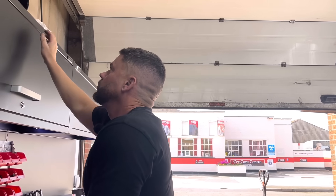It's all glued on these days — and a lot of stuff's glued together. At the end of the day, it's structurally fine because you've got most of the original quarter panels on — you've only got an over-fender bonded to the quarter panel, so the structure's still there. Same with the C pillar kit — it's holding the rear window and it's a plastic one anyway. I was watching Matt Armstrong a while ago on his channel — he had a BMW M5 and the strut tower on the front was damaged. He took the seam sealer off and all there was underneath was a little bit of tack welding — it was mainly bonded. Some of this bond now, Ryan said you will not get it off ever. The C pillar kit's going to be carbon fibre anyway, so once it's bonded to the car it's hell of a strong. It'll be a glued-together car.